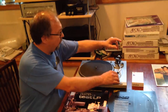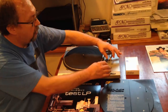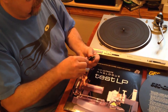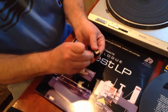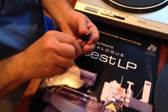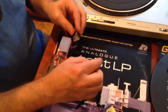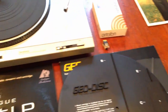The first thing we're going to do is get rid of this Audio-Technica cartridge. What I do is hold the cartridge carrier, the head shell, and rotate the sleeve out to let that up. We're going to undo the mounting screw, ditch the hardware, and pull this cartridge off. One screw gone, the other one's close — and out goes the cartridge. The stylus is bent; it's had a couple of collisions, so that is going to go away.